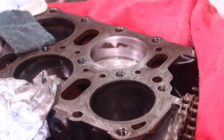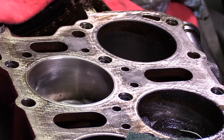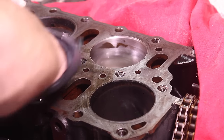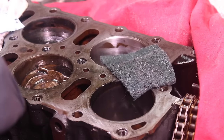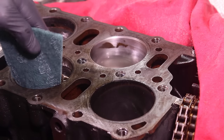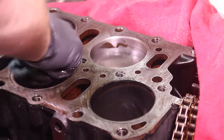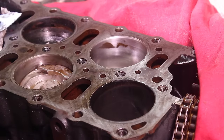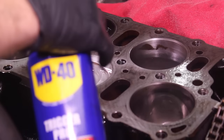As we finish each cylinder, we're going to want to rotate the engine around in order to bring the next cylinder up to the top, and we basically continue with each cylinder until we're done with all six. You'll know it's about time to replace the Scotch-Brite when you feel like you have to work a little bit harder than you did when you first started — so this one's about toast. Again, half of one of these lasts for about a whole cylinder. We'll go ahead and clean our final one.